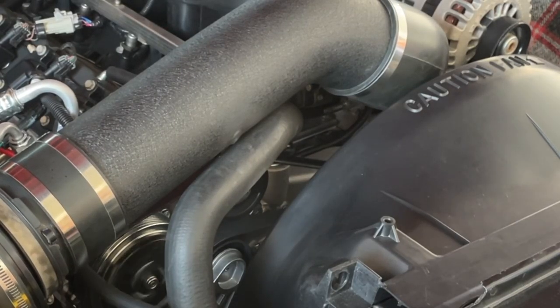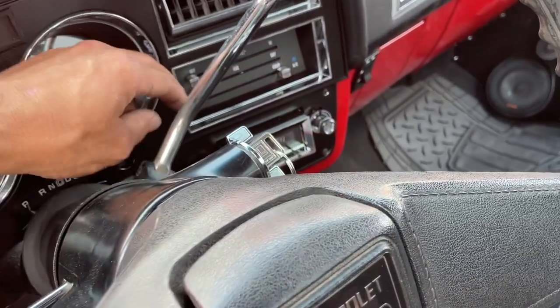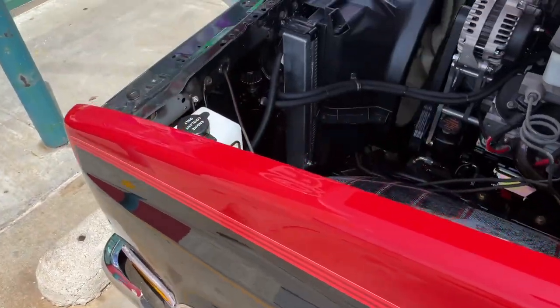It's rather disappointing — the AC did take a charge and didn't leak, so that's all well and good, but when the compressor engages the clutch it's misaligned immediately and the belt can't decide which rib it wants to run on the compressor pulley. I noticed the belt was bouncing around, so I came up to the parts store and just swapped it while they would let me. Turned the air back on and it seems to have fixed it with just a smaller belt.